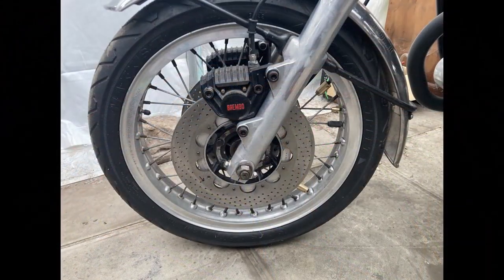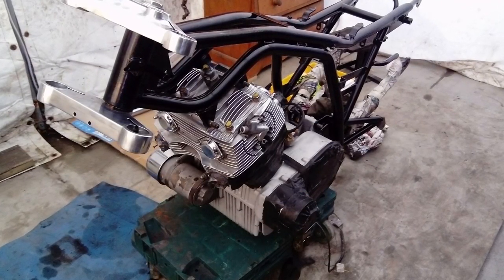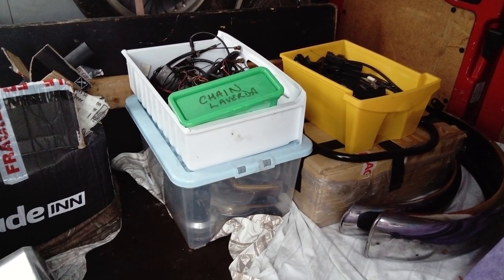The engine block isn't light, so it was a case of lowering the frame onto the engine first. I had sent instructions to the powder coaters to put a thick coat on, so mounting holes had to be reamed out for the bolts to fit — but this was the beginning of the journey back to life.